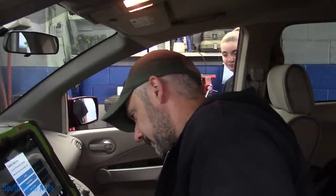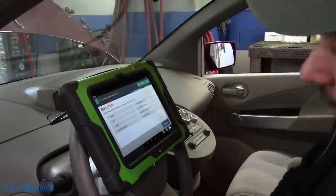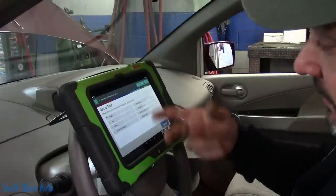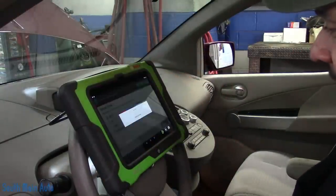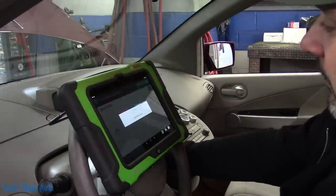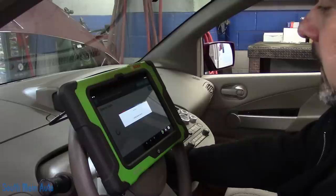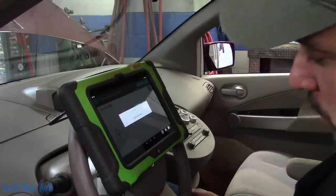I think he's got some stuff mixed up. I did start it — it does run like poo. I started looking at it yesterday, brought it in last night for the rain. I'll show you where I'm at and what I think happened. It does have just the P0300 stored. There's no misfire data in OEM information, but if we go to OBD2 I'm sure we can find it there. I'm going to show you what I've discovered. We'll fire it up — I don't want it running too long with a misfire. It was pretty obvious it was skipping on more than one cylinder.